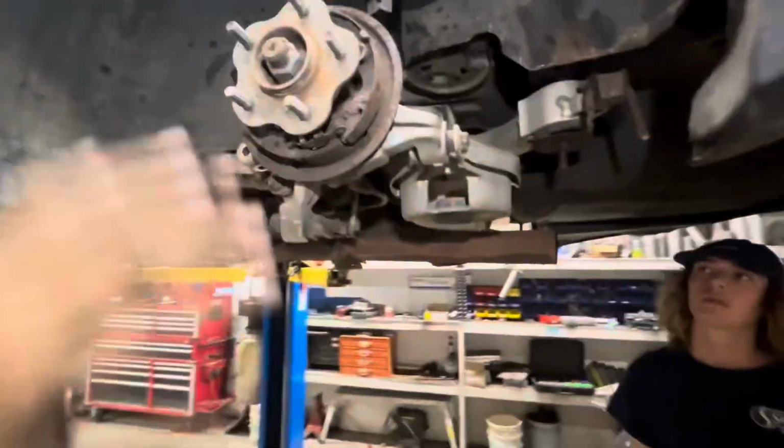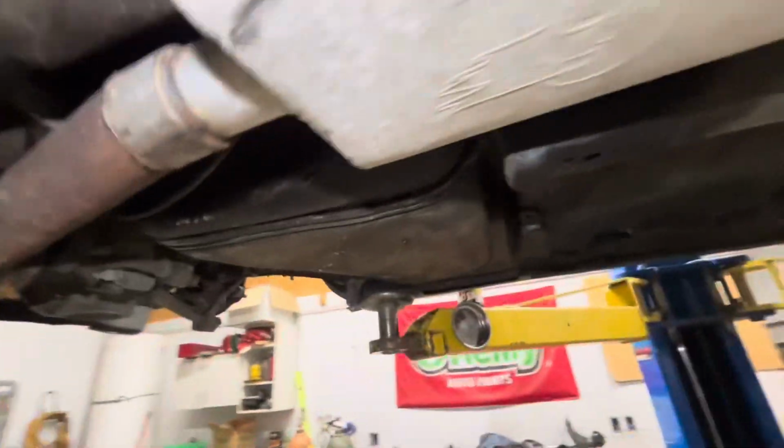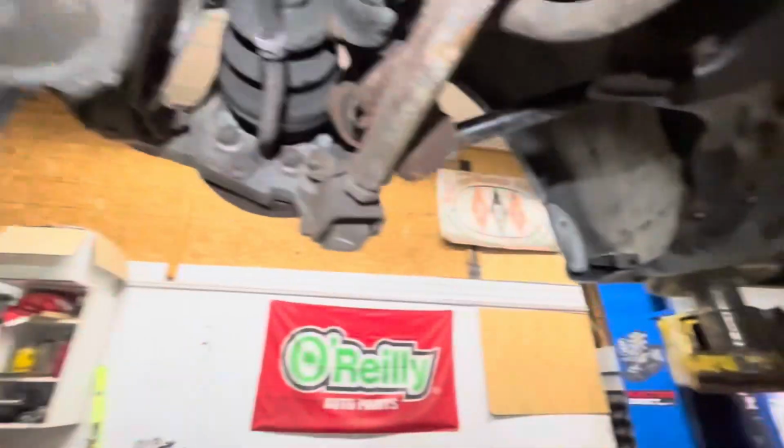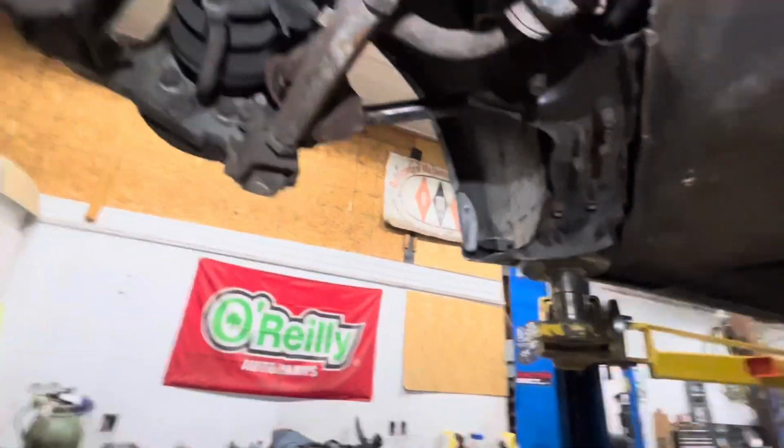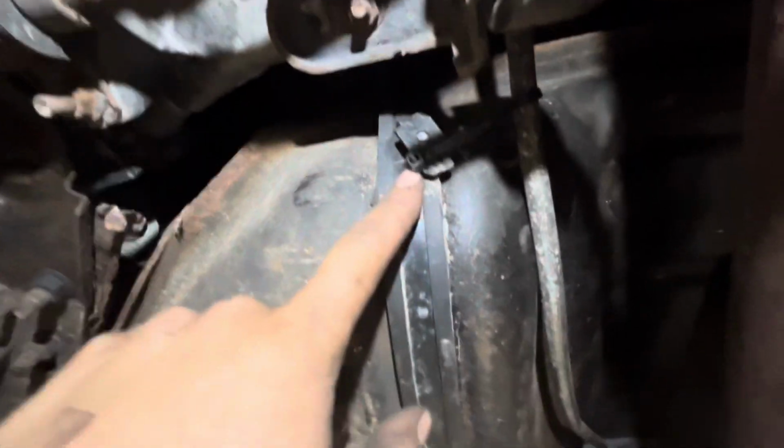All right, another update on the car. So the rear coilovers are in. I believe we just have the brakes to finish up. The exhaust is back on. Ignore it, it's temporary. The drive shaft is in. The heat shield is not there like we said previously. And we didn't actually remove the e-brake cables just yet because we don't feel like gutting the internals tonight, and we don't feel like cutting the cables, so we can't use them. But we got them zip tied to the heat shield mounting brackets, and then there's the bolt up there. Same on this side, bolt up there, zip tie here.